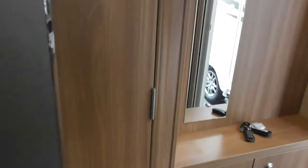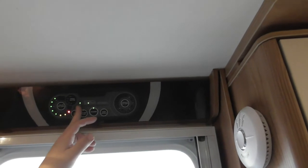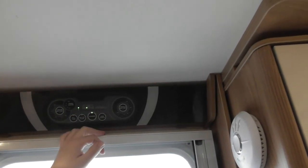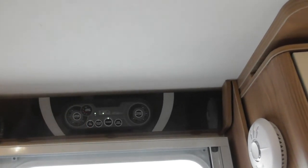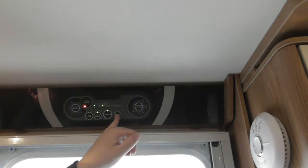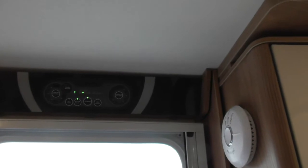Above the door — this should look very familiar. Power on, power off. On the top screen we've got the lightning bolt which lets us know we're running on the mains, and the light inside lets us know we're running on the leisure battery — those are the two lights you want to see when you initially switch on. We've then got view levels, which shows the condition of your leisure battery and how much water is in the fresh water tank — as you can see now it's empty because we're running off the aquaroll. Then we've got the water pump. When you switch the water pump on it beeps to say the tank's empty — just press view levels and it will silence that beeper. It'll always beep when you initially switch it on unless you've got water inside your tank.